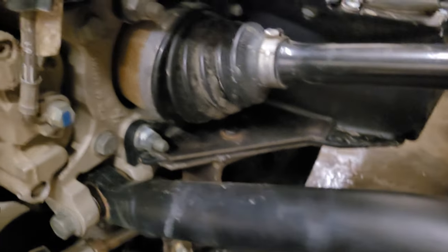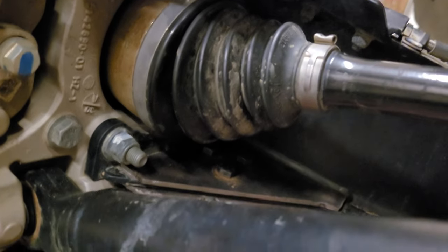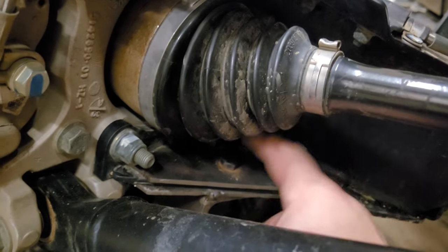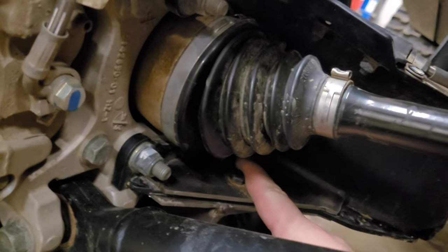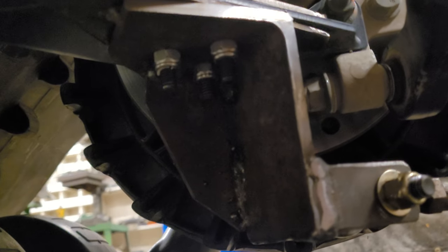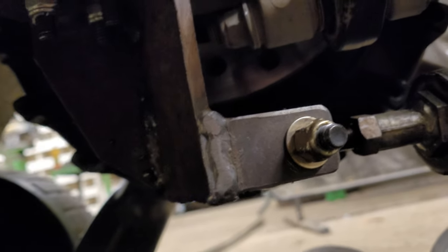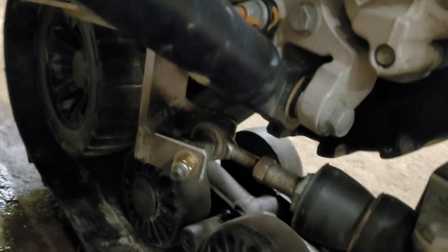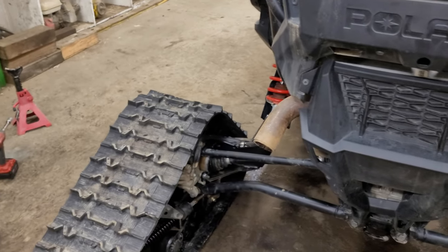The back is pretty simple. It's just sandwiching the trailing arm — this kind of big triangle piece — sandwiching it in there, then making a triangle that fits on top. It's on the bottom, and we utilized the scraper holes and added an extra one, so there's three bolts in there sandwiching it in. Then we made a drop bracket to get it out of the way of the suspension. Might have to make that a little bit lower if it runs into a radius rod, but we'll see how testing goes — it's pretty simple, just extend it down a bit or move it back, whatever it needs.